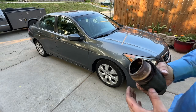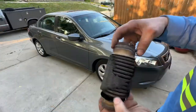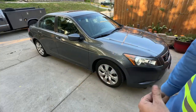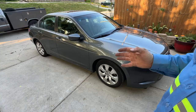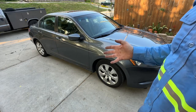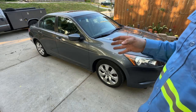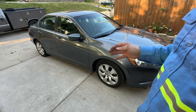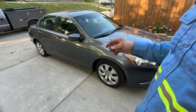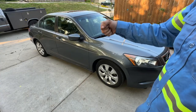Here's the one that was on it — it's broke here, broke here. It's just trashed. So it wasn't too bad of a job, frustrating to say the least. I kind of expected that going in because of that MIG gun that doesn't have a flexible neck and the nozzle's so big. Go out and get yourself one of those Harbor Freight Titanium 125s, because that gun is so small you can literally get it in anywhere. That's half the battle of welding exhaust — simply getting into the area to weld it.